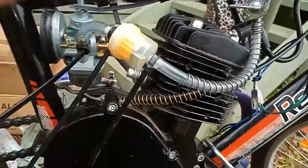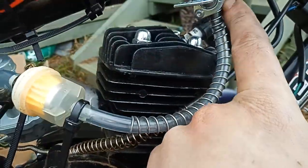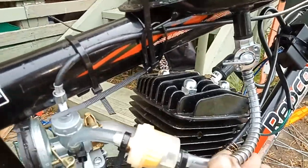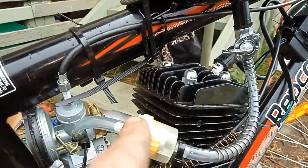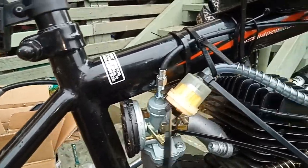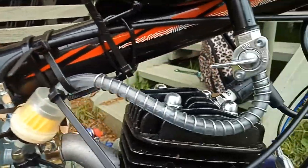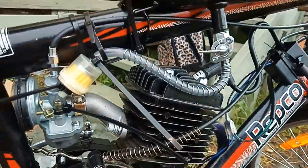My solution: I grabbed a spare clutch cable spring and wrapped it around the fuel line to try and protect it from the heat of the engine. All I really need to do is replace this length here and just shorten it — just to bring the whole shebang in — because at the moment all this fuel is having to go uphill, and it's a gravity-fed system. That's our more or less finished product. There is a slight uphill, but the weight of the fuel up top will compensate for that.